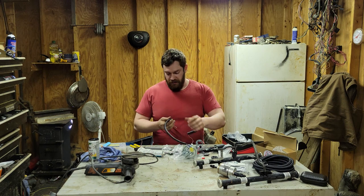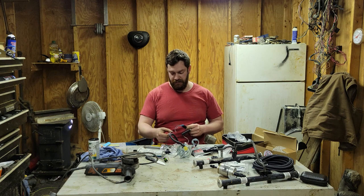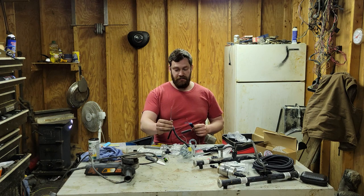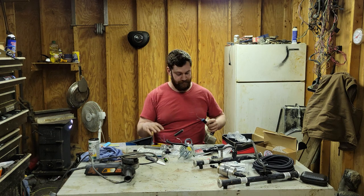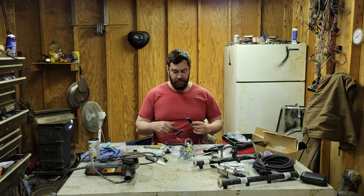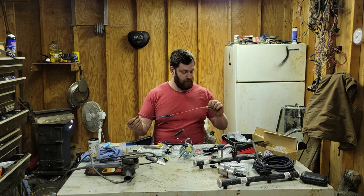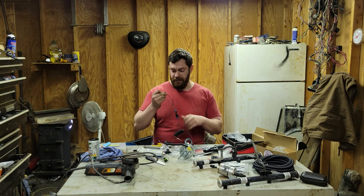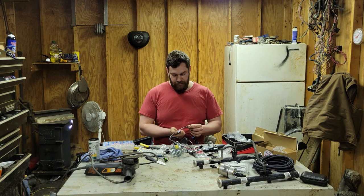Okay, so I'll start with wiring. So I'll use my blue on this side for the gray, which is, so gray is fuel pump power, purple is your sending unit, and then obviously this is ground. So I'll use the blue, which is also the red, or pink, to run the power. Same thing as the rest of your harness. Just get this and solder it on together.